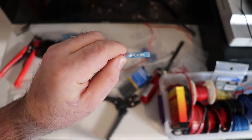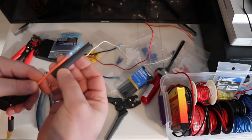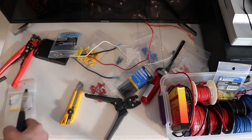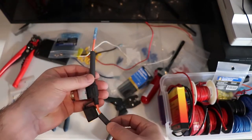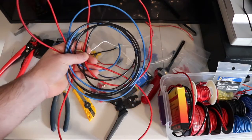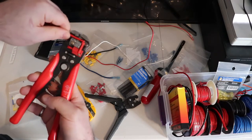I don't recommend solder — crimps are the way to go. You won't see solder anywhere on a modern vehicle. Make sure to put the shrink tubing on the wire in advance so you don't forget and have to cut the crimp off afterwards. I've cut about seven-foot pieces of wire for everything since it's cold outside — I'll snip the excess off when I get out there.